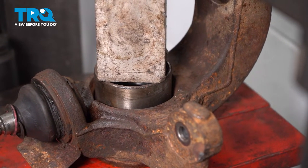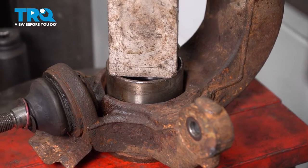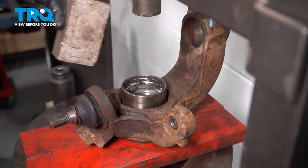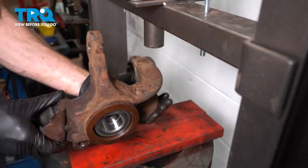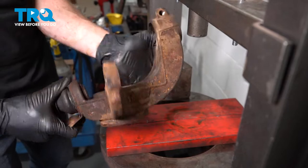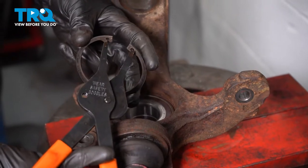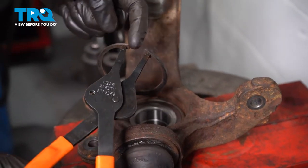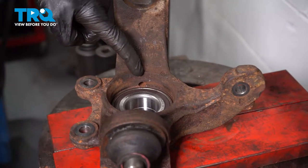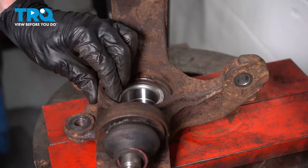It feels as though it wanted to stop. That essentially tells me that I should be bottomed out against the bottom side of the knuckle there. We'll just add a little bit more pressure just to confirm. Now we can release the pressure. Let's give that a quick inspection. Looking inside this area, you want to make sure it's completely bottomed out all the way around. This looks good. Have a look at the inside here. We can continue on with our snap ring. Let's get ready to install that snap ring. Put it on your snap ring pliers. Pay attention to the slotted area of the ring itself. Make sure you line it up with where the ABS sensor goes down and through. Slide this into position. Make sure it's sitting in the groove all the way around.